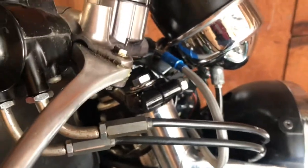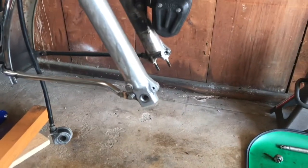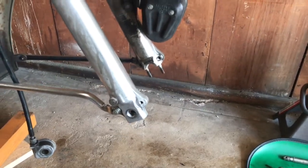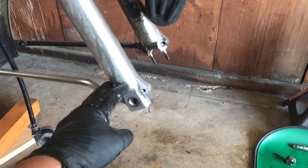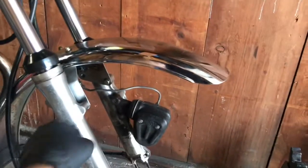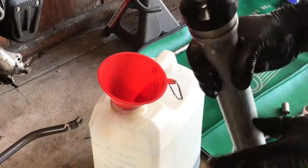Doing it this way on the bike, using the lock in that direction for leverage. Let's see if I can get that top loose. Someone's already been into this side — the Allen looks more like a Torx. They've been messed up so many times. I'm going to do it all on the bench instead — this is too much trying to do it upside down. So I'm going to take the whole fork out. The fork has slid out.